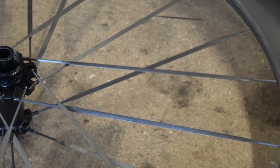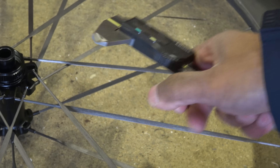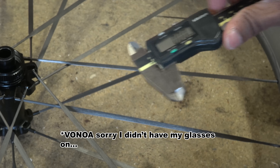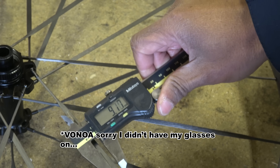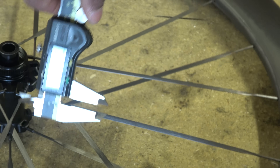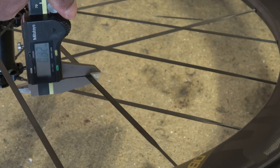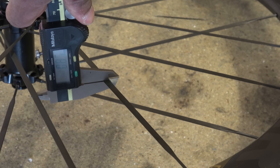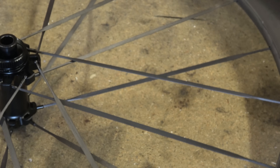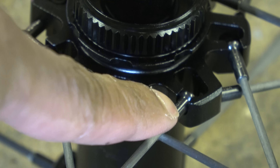These spokes are made by someone called Vonda and you can see they are pretty deep — approximately 5mm wide. The thickness, which you may or may not be able to see, is like 0.8mm. That is thin. At the hub end of the spoke they have metal inserts, the carbon goes through the middle and then flares around the outside so it can't come out.